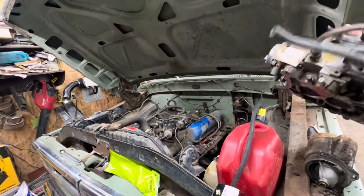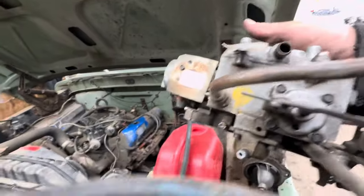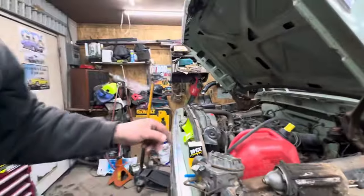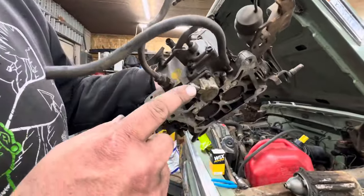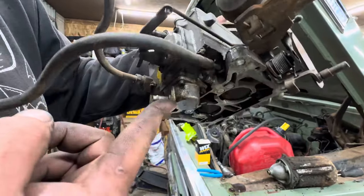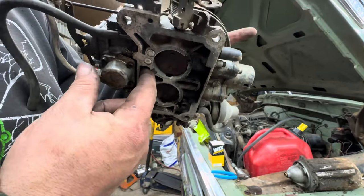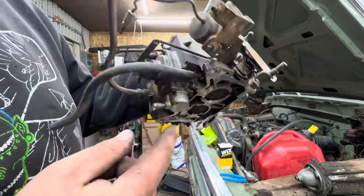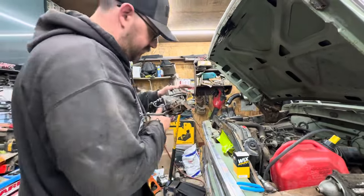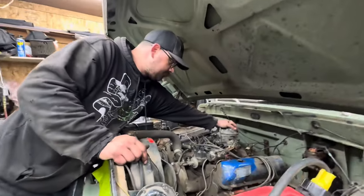But this carburetor, I screwed up. I never had this vacuum line hooked up. It's right on the power valve. Normally, I guess, the older ones took vacuum from inside. This one, you got to feed its own vacuum from the manifold directly to the power valve. So that might have explained some of the problems. Maybe it'll actually run all right.